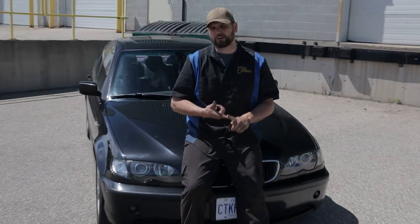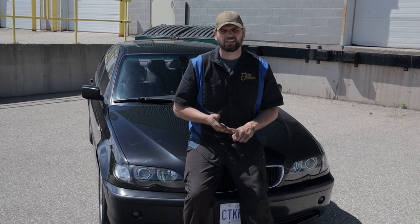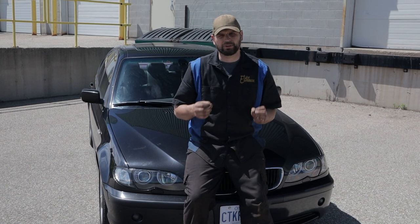Basic materials we used for this: sandpaper of varying grits. We had reinforced fiberglass Bondo and standard Bondo. We had the stainless steel screen for filling in the holes. We had the POR15 for treating the rust. Then we had color match paint, primer, and clear. So we ran a whole total of about $292.14. Keeping this one as a relatively inexpensive build.